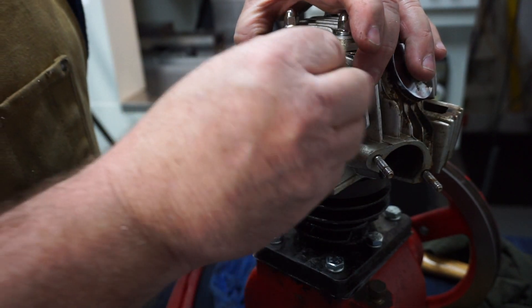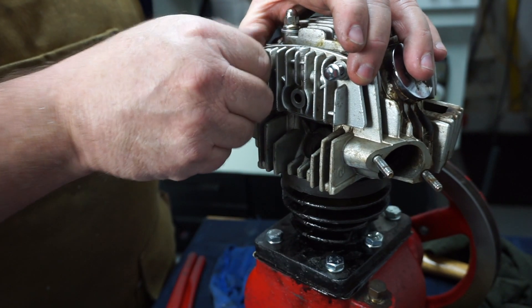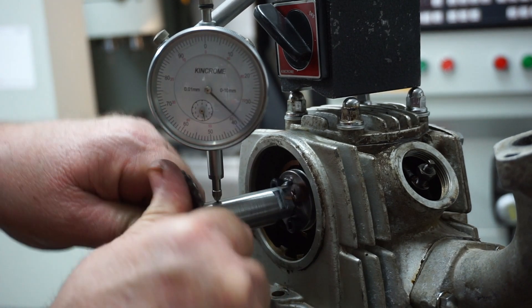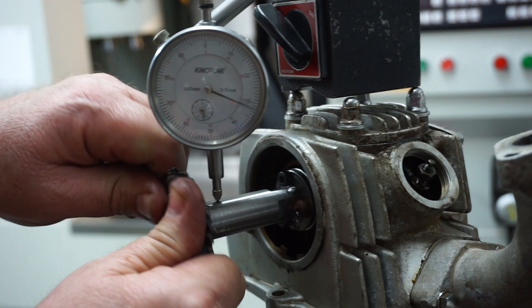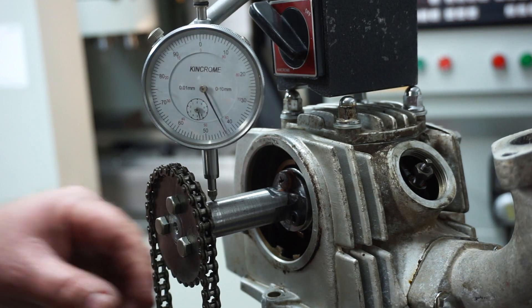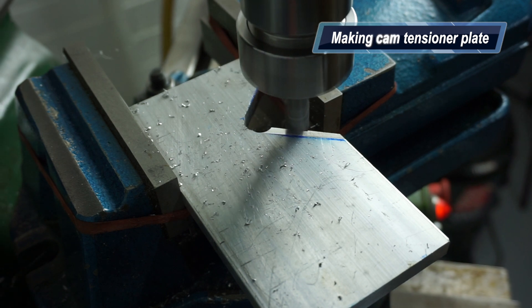I also had to retain that mounting plate so you can pull out the rocker arm shafts. I've set up a dial test indicator here for a preliminary sweep - I'm getting about 0.15mm runout. I popped in later with a soft face mallet and tapped it around to get the runout down to a much better level.